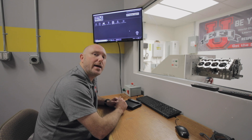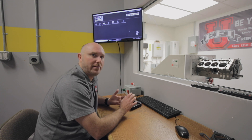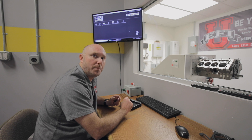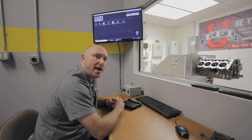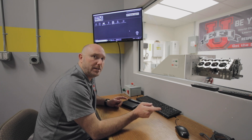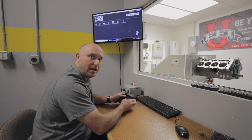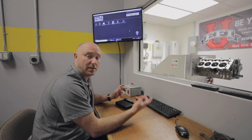Watch along and I'll show you how to set it up if you have Windows 10. Keep in mind if you have Windows 7, 8, or XP, you can always go to the help file in the Emtron software and it'll walk you through how to set that up. For now, if you have Windows 10, the first thing you gotta remember is you need to have your Cat5 Ethernet cable plugged into your ECU and to your computer before it will even detect that there's something there for it to look at.